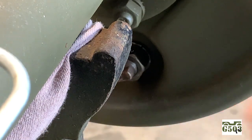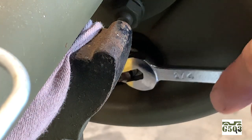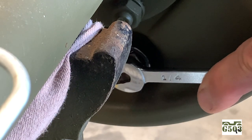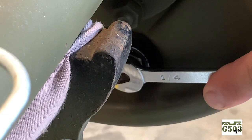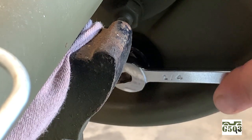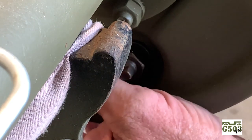Now this is the fun part, the special wrench. It's easiest to come in the back side here and get on that nut. Hold that pin with your wrench, and I only have to give it half a turn there, and it's going to tighten down. And you want to get these pretty snug. And then we'll check that with the feeler gauge one more time from the front. And that feels about right. So we're going to move to the back side lower and adjust that there.